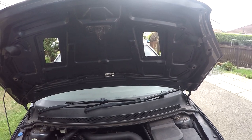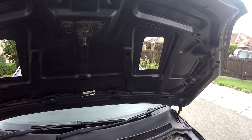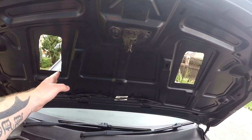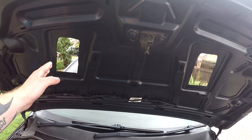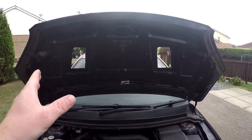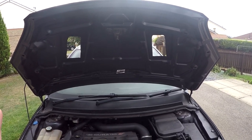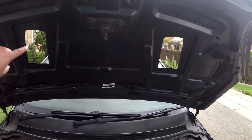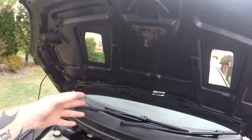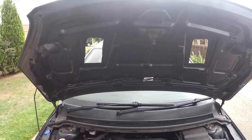That is a viable alternative if you're not comfortable using an angle grinder or reciprocating saw — it can definitely be done with a drill. If you do use either power tool, bear in mind the bonnet is thin, so you get a lot of vibration and it is hard to see the line. Do a bit at a time, work your way around carefully. As long as you're relatively close to the line, there's no drama. Once you've done that, it's very important to file the edges down so you don't have a sharp lip — you can easily cut yourself.